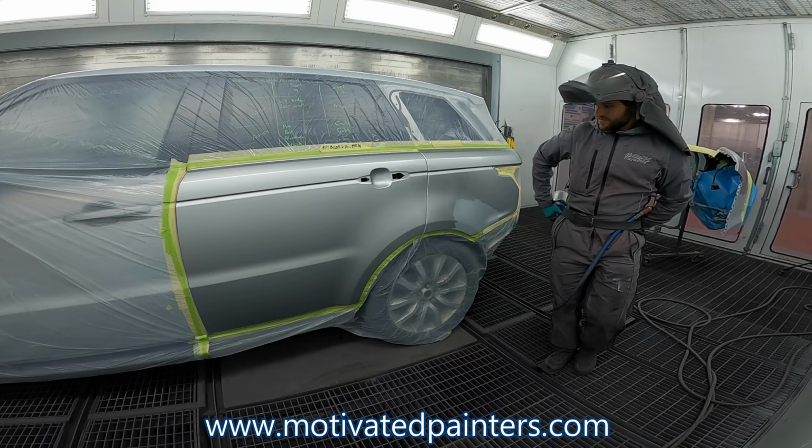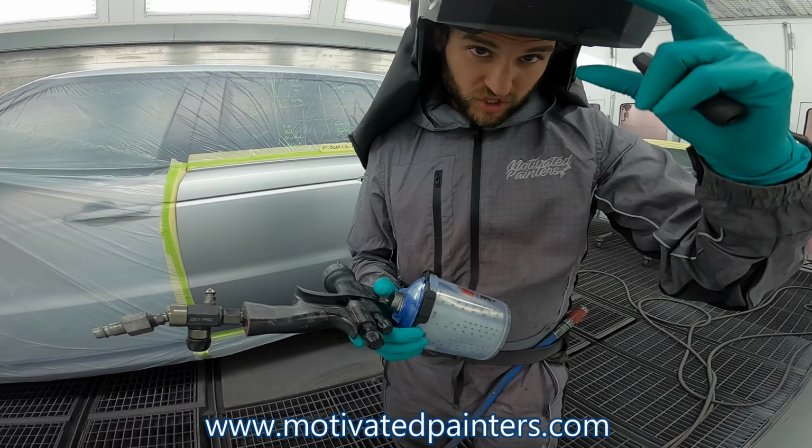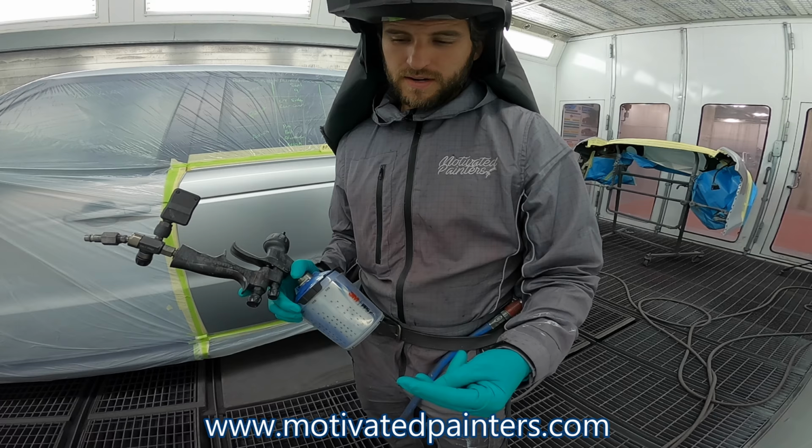That's flashed off. I got the code here, MEN, and it's PPG EnviroBase, of course. That's what we use here at the shop. And I did the one part base and then 10 parts 492, 5% 493, and brain fart, 10% 494.